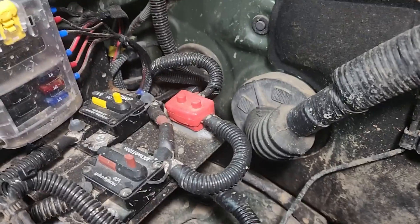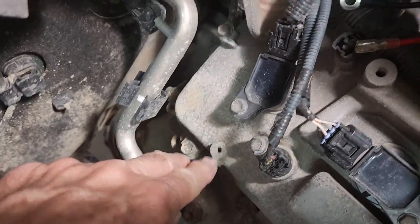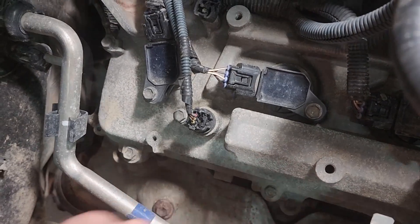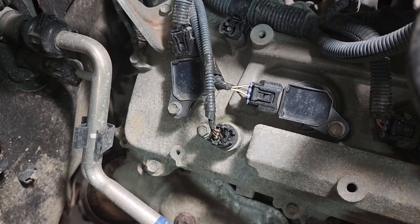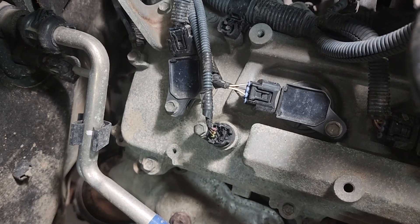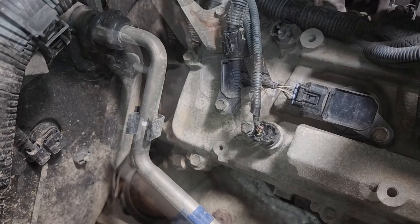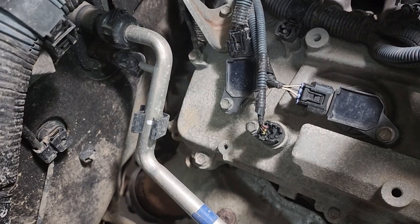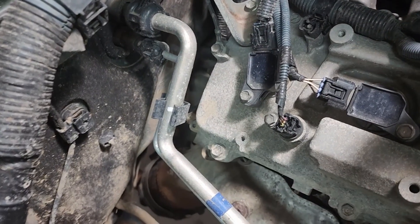So I've got three points of support, and I'd like something off of this end over here somewhere. There are a couple of threaded holes on the engine, which are a little bit tempting. The reason I'm probably not going to use those is because the engine is on rubber mounts and the body is also on rubber mounts — the engine could be moving one direction while the body is flexing a different direction, and bridging between those two independently moving things with a little metal shelf would be problematic. So I'm going to avoid using those tempting locations.